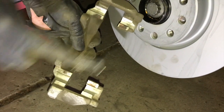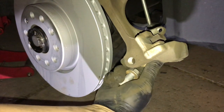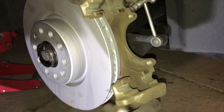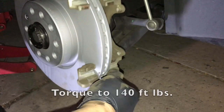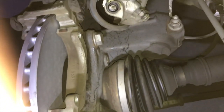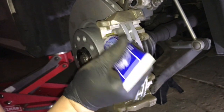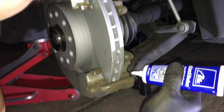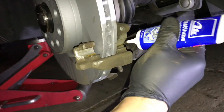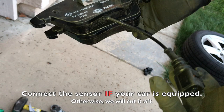Be sure to clean the carrier — use a little brake dust cleaner and just brush it off. Then put the two carrier bolts back in, bottom one first, then the top bolt. Grease the area where the pads will be gliding on the caliper bracket. We got the new pads and they have a wear sensor, so we are probably just going to cut it off.